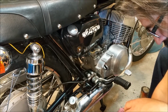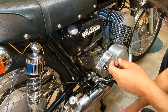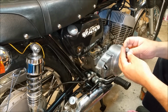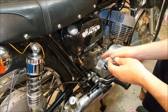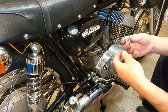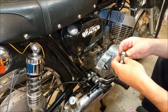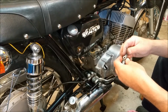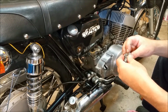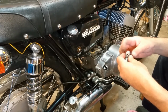The other thing is the oil, what do you call it? Oil tank. I was a bit concerned with how it all connected up. Of course, we've got this thing here. One of these, the tank, and these have, one of them has a left-hand thread, and of course, there's a small washer that goes in the rebate of this special nut, which is cut right and left hand. So that would be your right hand thread part there, I think. Hang on, which way does this go? Nope, it goes that way. Yep, it goes down like that.